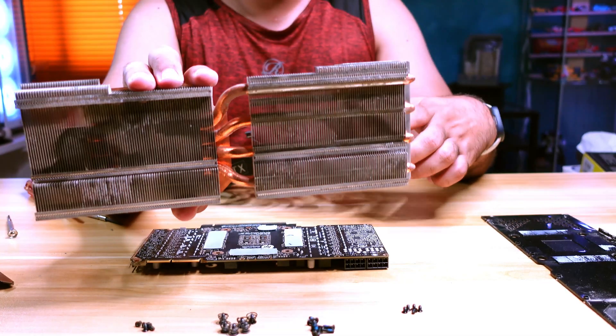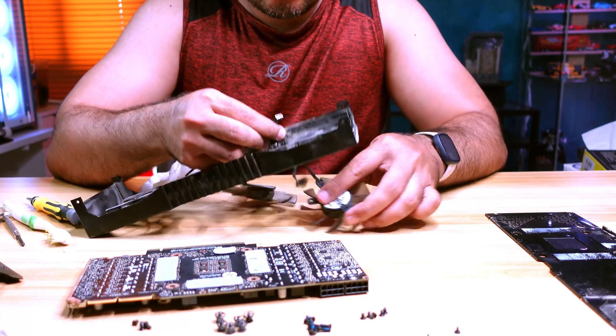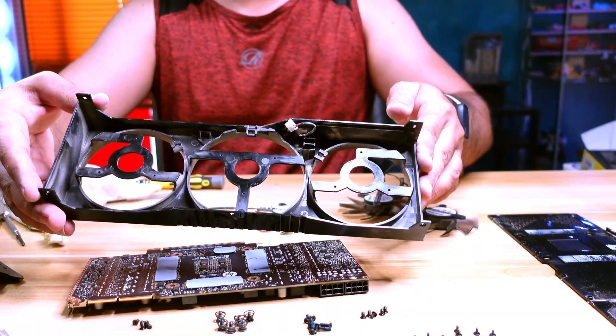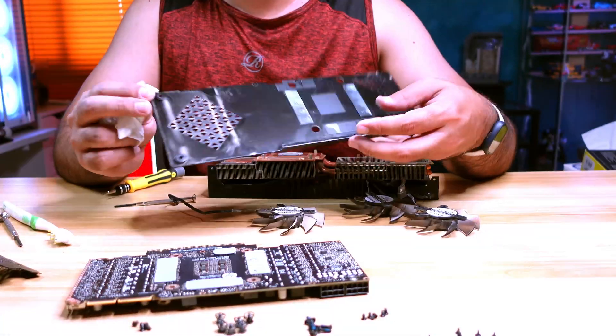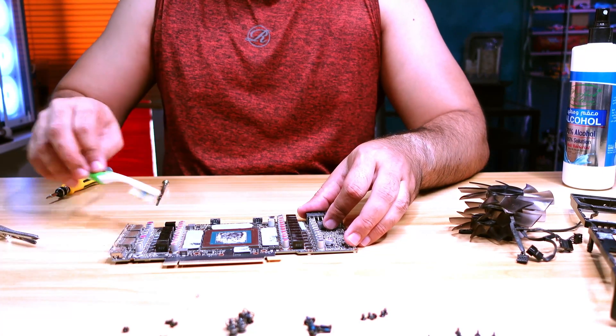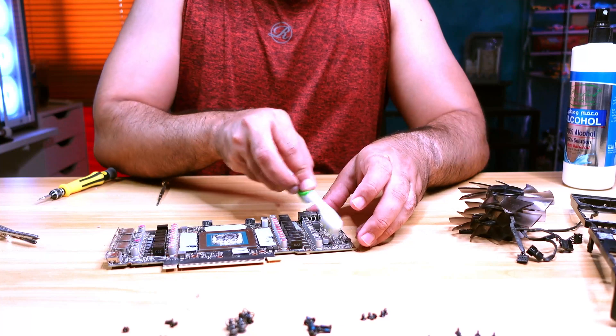This is what a dirty heat sink looks like. There will be three screws on each fan — just remove all of them so that you can remove the fans to clean them easily. Let's have a final quick look at the dirty fan shroud, copper heat sink, and the metal back plate. I am cleaning the main circuit board with only a dry brush because it was already in neat condition, containing only minor dirt residues.